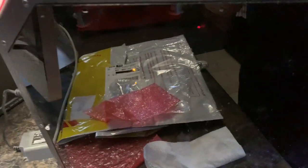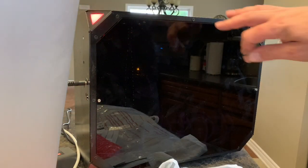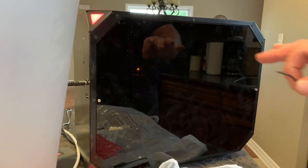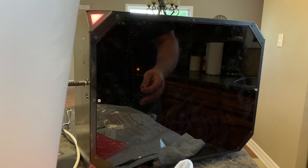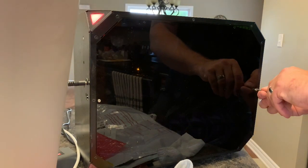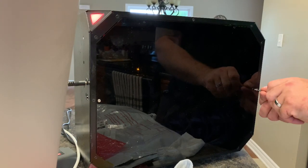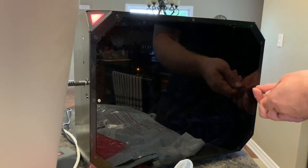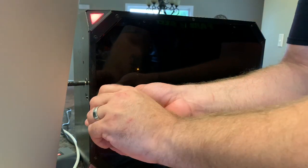I've got the ReefBot set up here with my laptop and the SD card. We have to come around the back and take off this part — this is where the SD card is and all the motors. We're just going to take the back off using a typical Allen key. There are ten screws total; I left two for last time because it didn't happen again. I wish I had known the first time — all it is is a corrupted SD card. This way we can all learn together how to change out these cards if you ever have a problem.